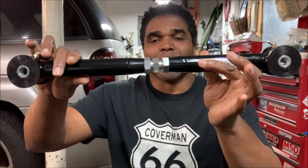You've got your transmission and your rear differential, and between the two is the driveshaft. You want to make sure the rear differential and the end of the transmission are in degree with each other — because if they're not, you're going to get all types of vibrations at low speed and high speed. With the adjustable upper it gives you the maneuverability to move it up or down to whatever degree you want, especially if you're racing and want a little more degree off launches.